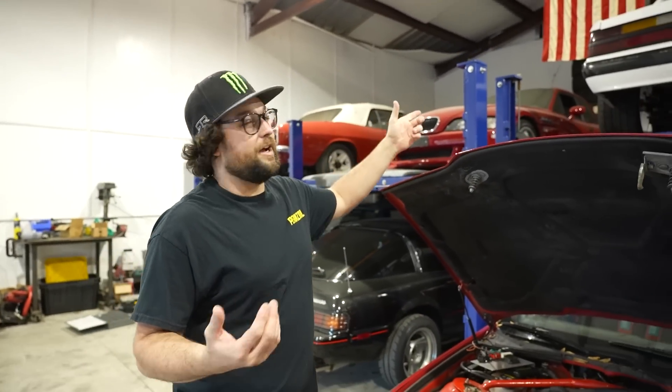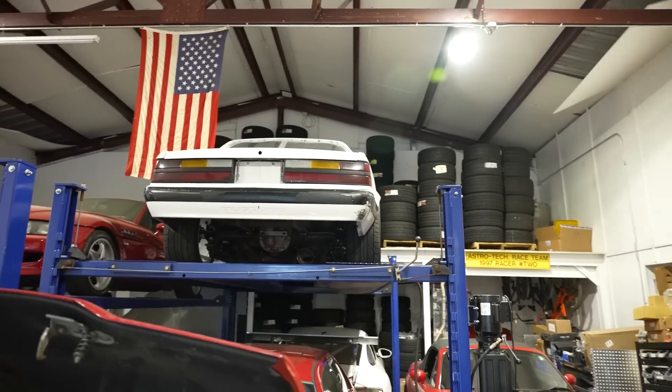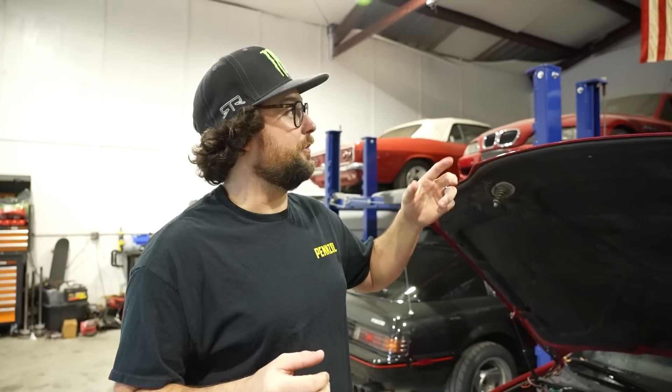The Fox body is kind of the same as it's been. I had to put a new tail light on it, and when I did I realized I also moved the quarter panel a little bit with the hit - that sucked. We took it out to the track and tested it again, and we could not replicate the problem we were having at LZ. Refixing the fuel map and changing it - tricking the ECU into thinking it was at less pressure than it actually is by scaling it - makes it so it doesn't have as big a window, and it's been running fine. Hopefully Link comes out with their new ECU soon, which is supposed to be very soon, and that will solve all those problems and let us turn the power up. The turbo manifold just got finished up investment cast style, so we're putting on the G30 770 to hopefully push 480 to 500 wheel - more than that car really ever needs, especially for the small tire events we're doing this year.